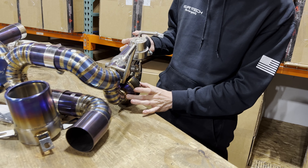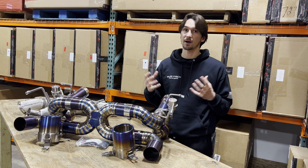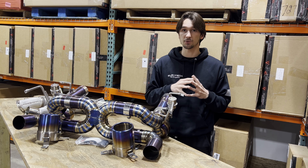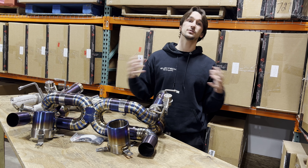There's a resonator — kind of a bubble-style resonator here — to have the exhaust gases expand into it, lowering decibels by about 10 dB on the cold start, which really helps lower the overall aggressiveness so that your neighbors don't hate you.